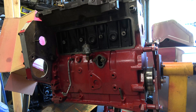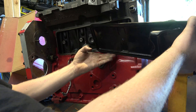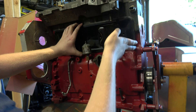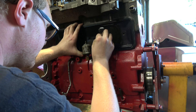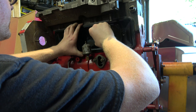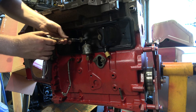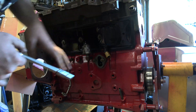We've got a new gasket here for our tappet cover and I'm going to put that on. One of these screw holes holds the return line for the injection pump — I think it's this one on the end here, but I don't know for sure. Just snug it — I can't really torque it. That one's pretty good, that one's going to leave, we'll do that one last.